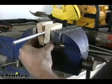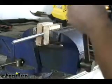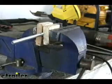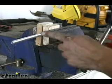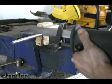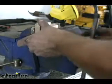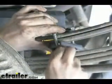Shortening the bolts will be pretty simple. We're going to get a couple blocks of wood, put it in our bench vise and clamp it down. Here are our marks right here. You can take a dremel or any type of reciprocating saw — just stay in between the threads. One down, three to go. These are locked up so I want to go a couple threads past the mark.